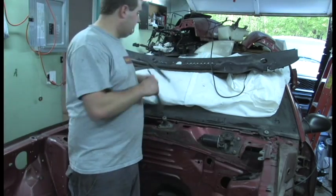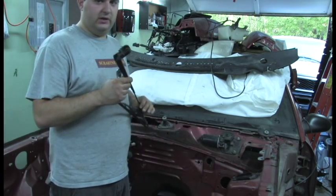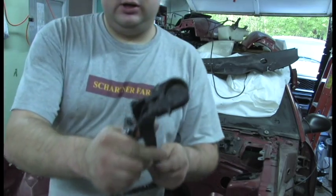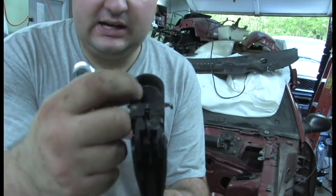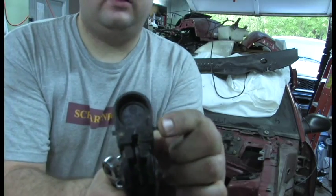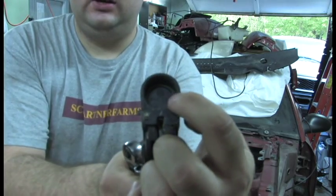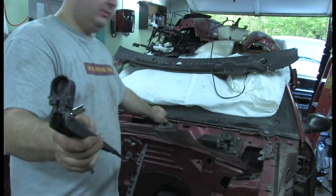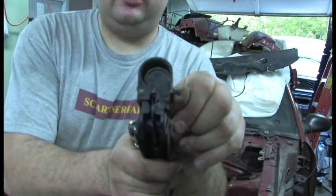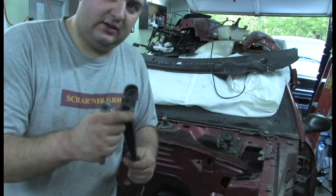If you have it assembled, you have to remove the cowl, and before you can remove the cowl, you have to remove the wiper arm. This is fairly simple to do. If you take a look here, you can see the edge is splined, and there's this little locking mechanism. If it's locked like this, you can see the notch will sit underneath the splined arm here and lock it into place. So basically you just take a screwdriver, slide it over, and then you can wiggle the arm off. If it's been on there quite a while, it's tricky to get off.